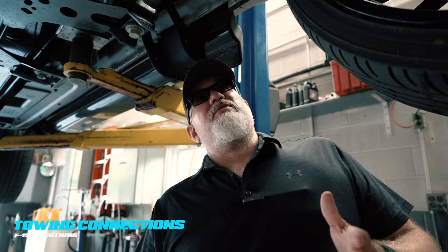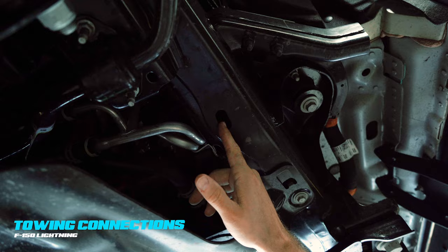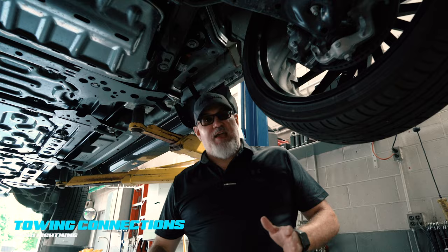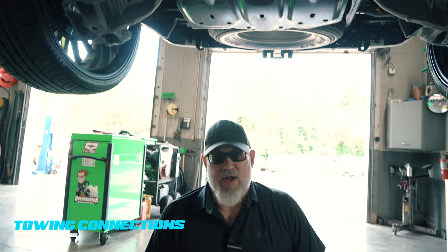Right behind the front sway bar there's a slot in the rail on each side — Ford has identified this as a connection point. Throw a mini J hook on each side with a nylon bridle. It departs very cleanly across the skid plate, lightly touches the valance, and loads really easy with no damage. For you guys who like to run vehicles down on winches — you have to stop doing it, especially with EV platforms. You cannot run these EV platforms down on winches. I know it's easy to come in with a big meat hook and throw it around the rear control arm and run it down on the winch, but you're going to damage something on the control arm or suspension. Winch it to the carrier, get it where you want it, and bind it down with an eight-point kit.